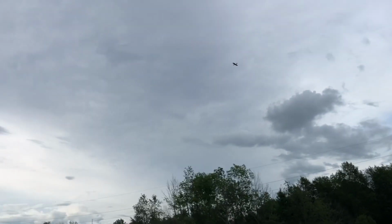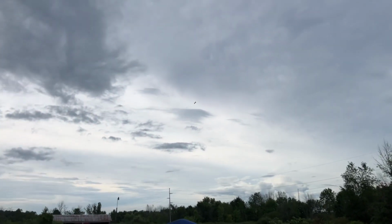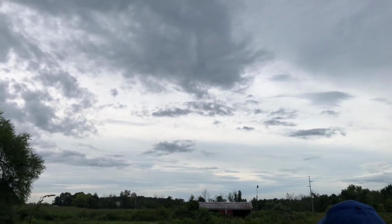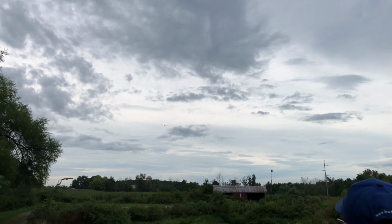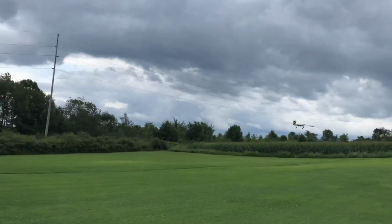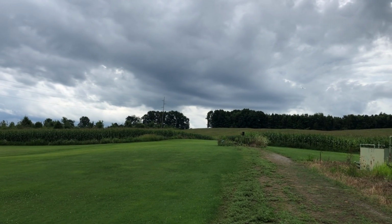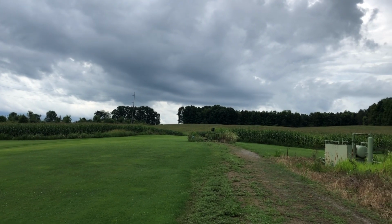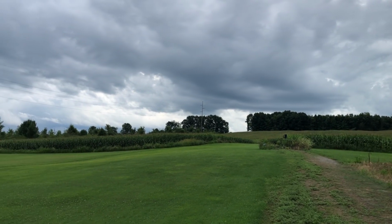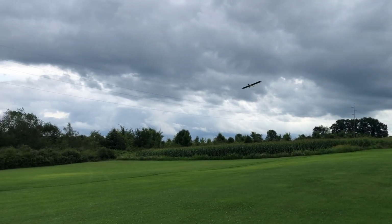And we're using Husqvarna XP2. If you look up anything on two-stroke oils and you look at the testing, that's one of the best ones that there is as far as testing goes. So we use it and we really, really like it. Engines look clean. They run about 20% cooler on the XP too, if you run a temperature sensor on them.